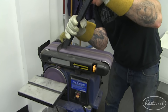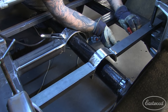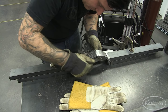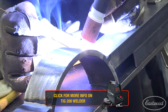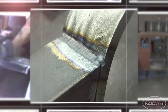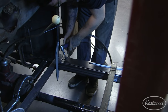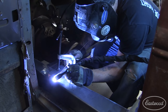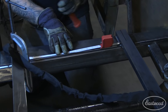Now we moved on to making our cross bracing for the subfloor. Because we've dropped the body of the car down over the chassis, our drive shaft now sits higher than the height of the floor in the rear. We cut a piece of schedule 80 pipe in half to make a quick hoop for the center of our rear brace. We then used the TIG 200 to weld the three pieces together. The rest of the cross braces were cut to length and we worked our way towards the back of the car, spacing each brace out evenly and welding them in place.